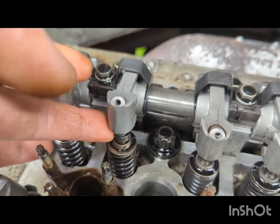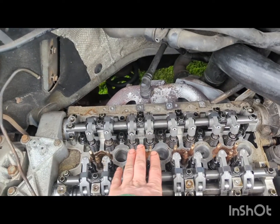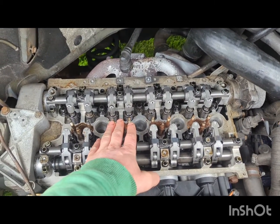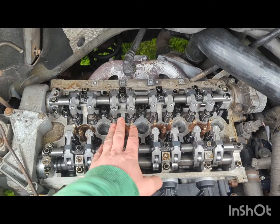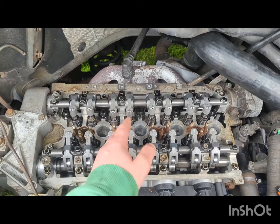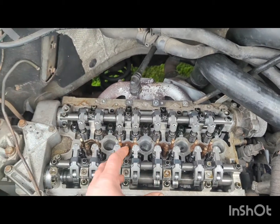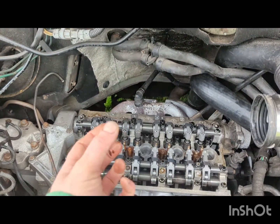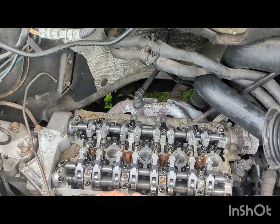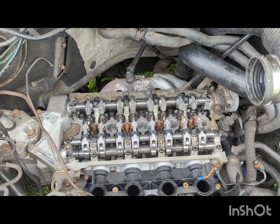The little cap is loose on cylinder one, but it's actually cylinder two that's had the failed bottom end bearing. What's happened is one of the bolts has come loose, gradually worked itself loose, then snapped, and the bottom of the conrod has locked the crankshaft in place. I'll get underneath now and show you a better look at that.